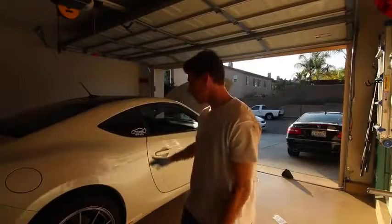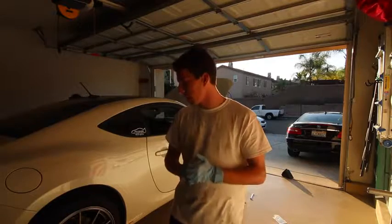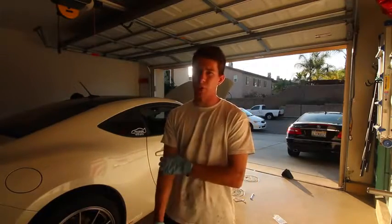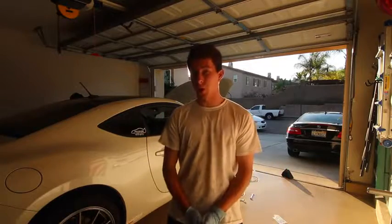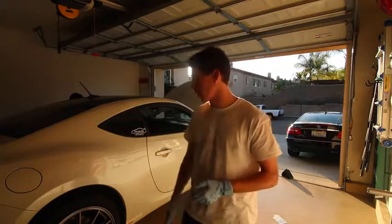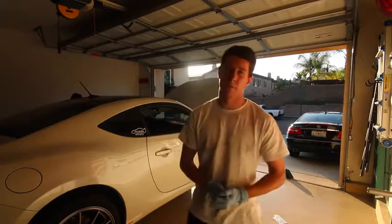So after starting the car, there's a small leak from the mid pipe and front pipe. There's nothing we can do about it now. We've already tried to mess with some of our alignments, and unfortunately, there's just a slight gap, and even with our gasket, it doesn't fill it. So obviously now the car won't pass emissions, but that doesn't matter. I don't need to get it smog for a couple months. So what I'm gonna do is in my next spare time, I'm just gonna order some more gaskets offline and put two more in there, and it'll easily fill up the gap. Other than that, we're gonna put the panels back on and drop the car, because as for now, there's really not much we can do. The car works fine. I haven't run any cell codes or anything, so it's all good. So let's drop the car and get some more sound clips.